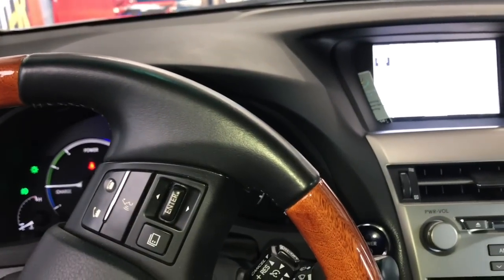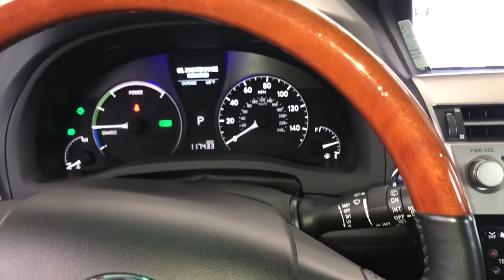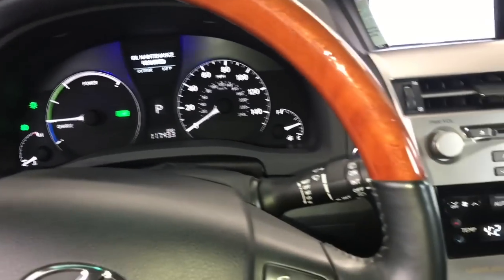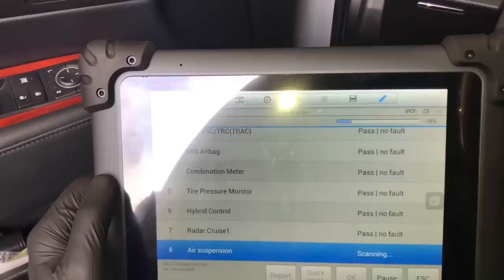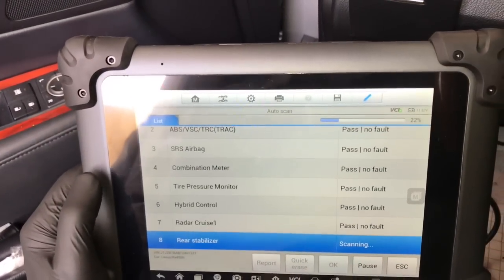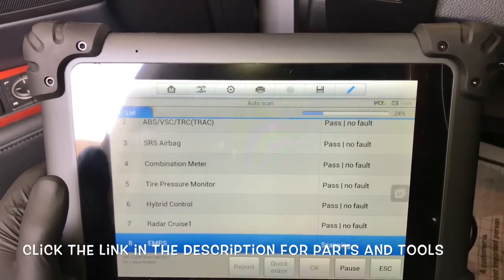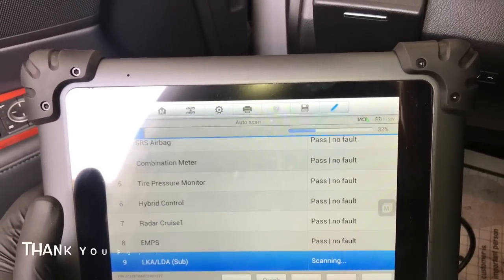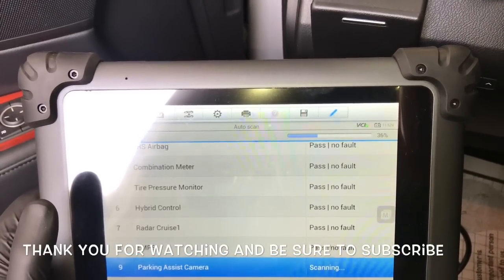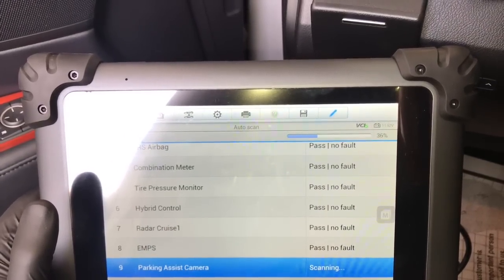I powered up the car by putting the key fob back in and pushing the power system on — just let it power up without my foot on the brake for a few seconds, then started the vehicle. After that I installed a scan tool and ran another full system scan to make sure there are no codes in the hybrid system or anything like that. After verifying there were no problems caused by the work I did, I went on a test drive. I'll link all the parts and tools I used in the description — that'll complete the job of replacing the spark plugs on a Lexus RX 450h. I'm Brian Esso from How2 Automotive. Thank you for watching — please subscribe and visit HowToAutomotive.com for more videos like this.